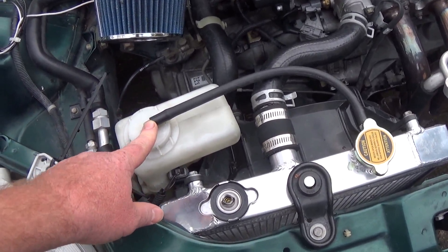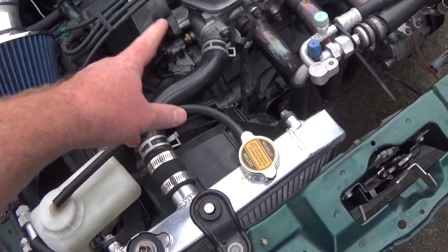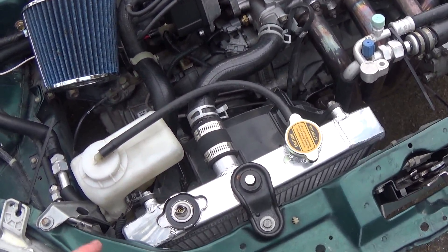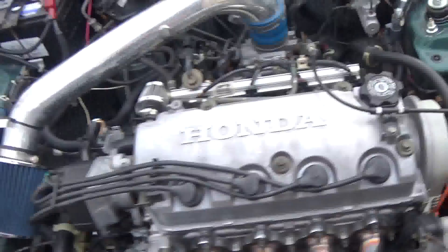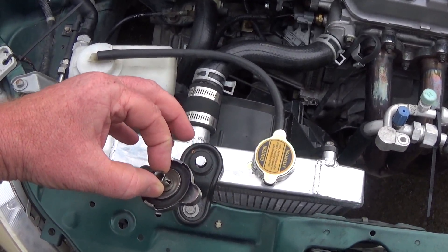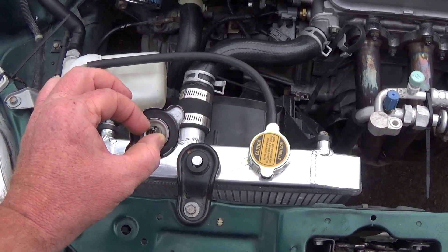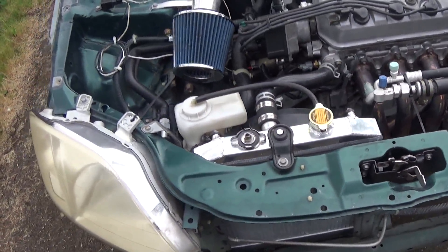I actually did take a test drive. So that's a method of what I call burping your system — getting the air pockets out without having to pay much attention to it. It's kind of a cheap tip: just get a radiator cap, make sure it fits, take all the guts out except for that final seal, and you can use that method to help get the air pockets out of your car faster.